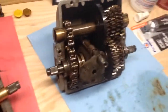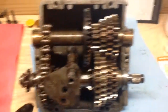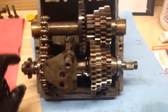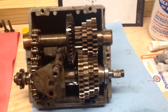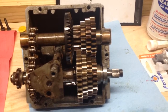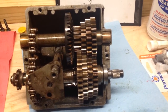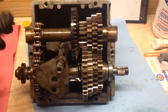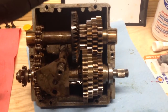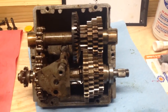For the four wheel drive, this is one sprocket that would go on the outside — it's got eight teeth. I'm going to get the same eight tooth sprocket for the other side and run one chain to the front axle and one chain to the rear axle, which will give me four wheel drive. Just like in a four wheel drive Jeep or truck, putting it into gear — whatever gear I'm in, both chains and sprockets will run at identical RPMs, turning the axles simultaneously. I also use independent suspension, so I'll run the chains to a live axle that's solid and fixed with pillow blocks, and then CV shafts will run from the solid axle down to each wheel — full wheel drive with independent suspension.